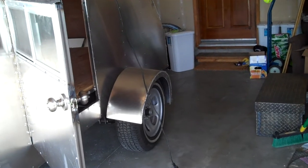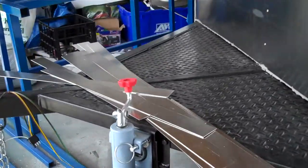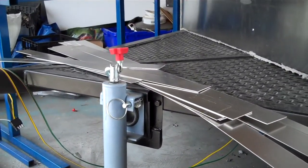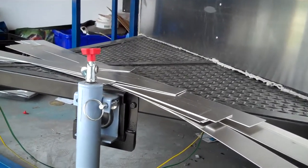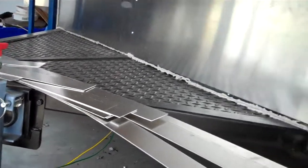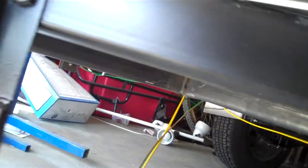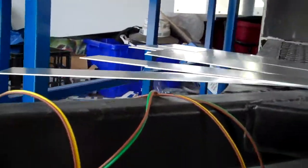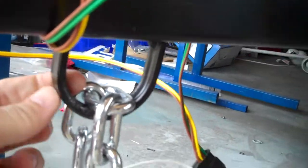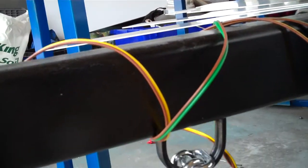Those are Jeep wheels, and snow tires — I took the studs out of them for the trailer. Built a bracket up here; this was a weld-on jack stand, but I wanted to be able to remove and replace it, so I made it a bolt-on jack stand. That was one thing I had to fabricate — that bracket there. Also fabricated some little mounts back here for these lights. Still need to secure these wires up here. Made this out of some U-bolts — welded them together, cleaned them up, welded it on, put the chain on. Safety chains.